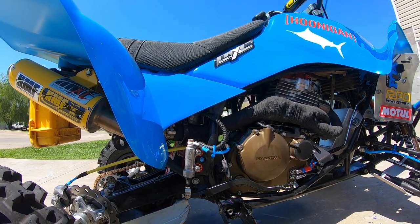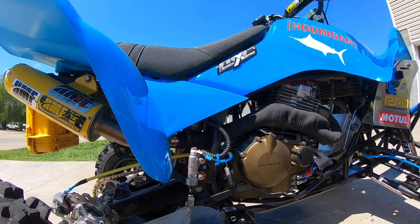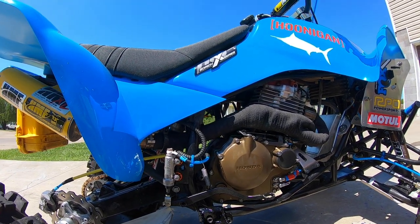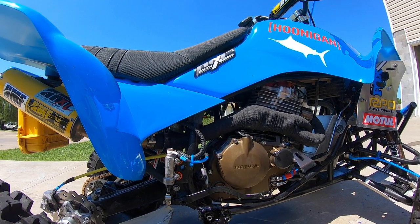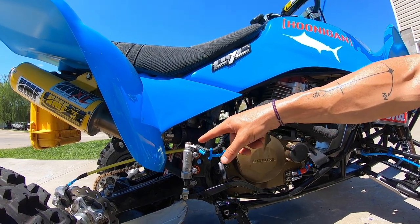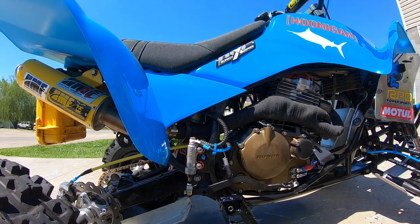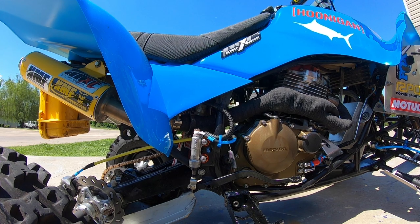First thing we did was we eyeballed the swing arm and ordered them at, I don't know, like 17 inches, way too short. Went back and measured the OEM brake lines and could swear that we came up with 31 inches. So we ordered 31 inches and we're a little long. And so we wrapped around the front and back onto the master cylinder in the back. It looks all right. And we got a little extra length if we do want to put in a swing arm down the road.